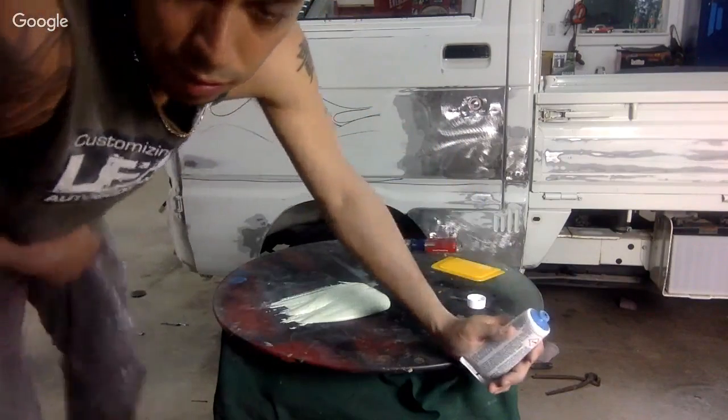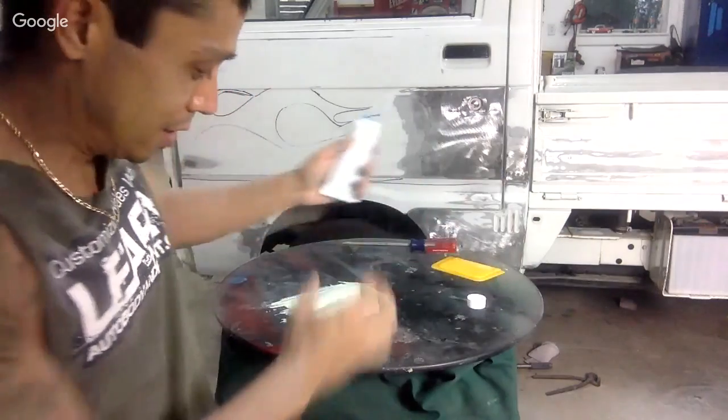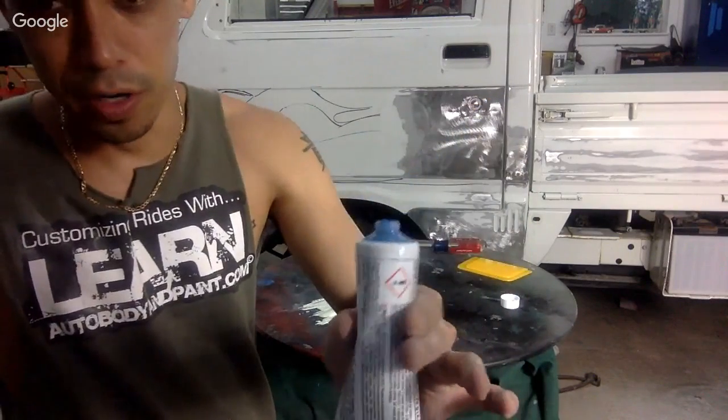Okay. My father's rule: for every golf ball size of filler, you're going to put about six to eight drops of hardener.